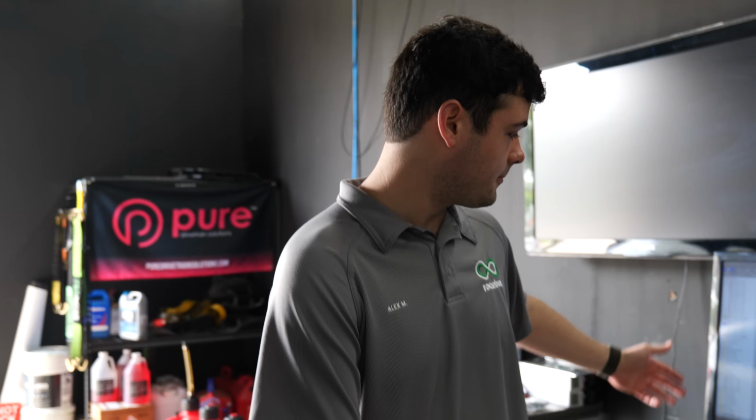This one does have the AMS, the new AMS dual low pressure setup with the basket and everything, and it has worked phenomenally. The car is down to the last run, it made 740 wheel horsepower. The car is under an eighth of a tank. It's flashing 10 miles of range at me. Nice. And no fuel cuts. No fuel cuts. So this low pressure has worked phenomenally.